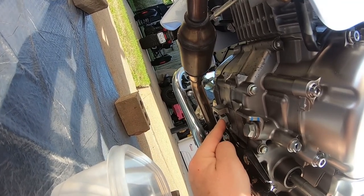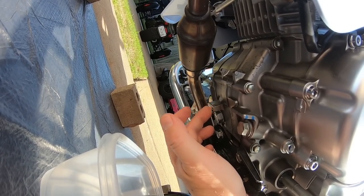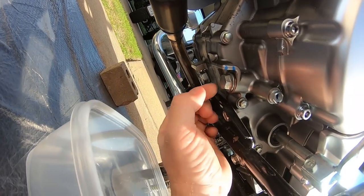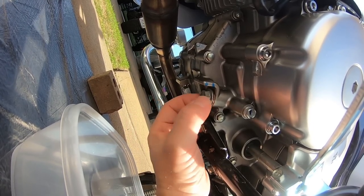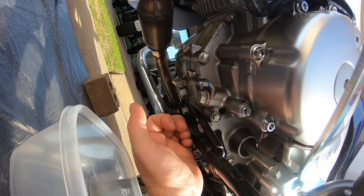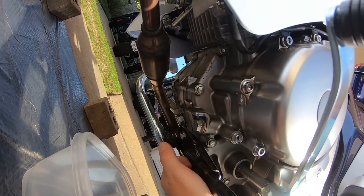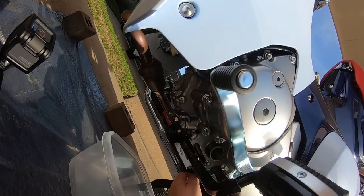There are two drain bolts. The one that's typical on most Hondas is covered by this extrusion on the case — that's where I always look for them. That's how my PCXs are, and my son's CRF110, which has a similar bottom end. The other one has a copper sealing washer on it, and whenever I see those I generally think transmission. Not really sure, I need to get my service manual. Anyway, I know this first one is the drain bolt, so that's where we start.